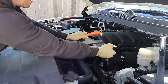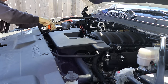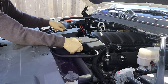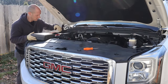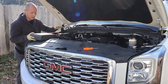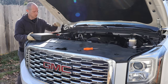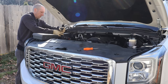We'll loosen up the boot on the throttle body. There's a breather on each side — just press the little white tab and it pops right out. We'll disconnect it from the mass airflow sensor and pull it straight forward off its little mounting tabs. So much room for activities. To keep the mess to a minimum and lose as little antifreeze as possible, we're going to pull it into a vacuum while we change these heater hoses, one at a time, using our little airlift.